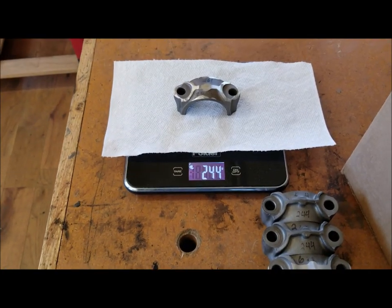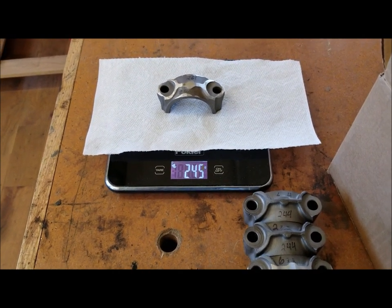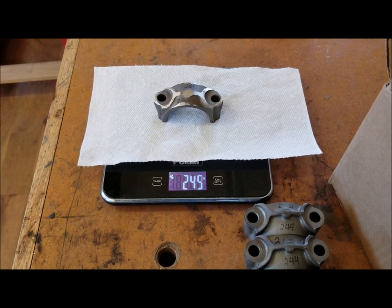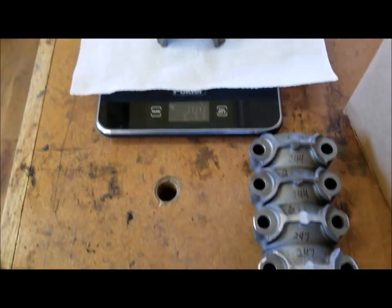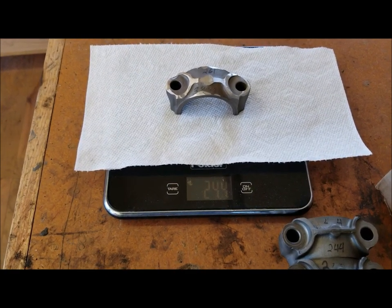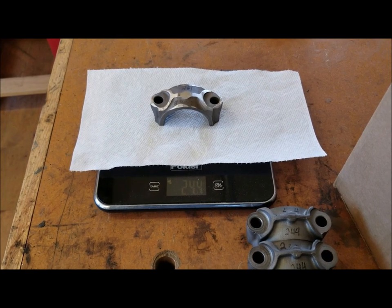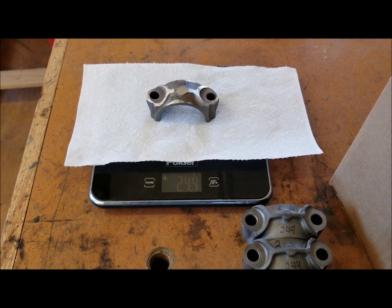I wasn't certain I needed to do this, and I will confess I was wrong. It is absolutely alarming how much metal I had to take off of that one single cap to get it to 244 — actually now it's reading 245 grams. That's 15 grams difference between the smallest and that one. It was shocking how much metal that actually looked like. I feel like I just butchered the thing. I can't even imagine — 15 grams is a lot rotating at 3,000–4,000 RPMs. That would be quite a bit of shake in the engine.